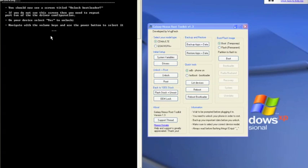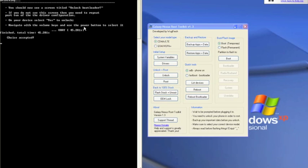Make sure you read the instructions here. I'm just highlighting what I'm doing on the device as we go through, so it's pretty much happening in real time. Go ahead and navigate using the volume buttons to go up and down and change selections, then press the power button to select. Wait for your device to boot up so you can get USB debugging back on.